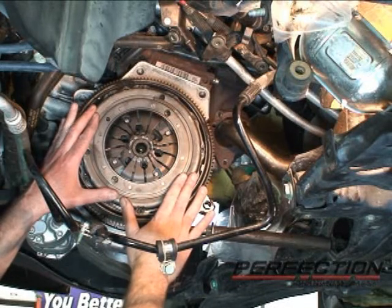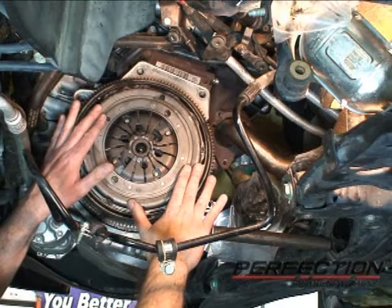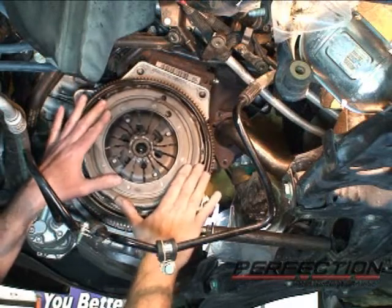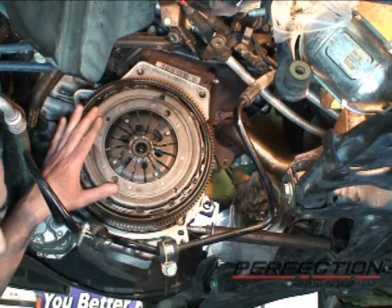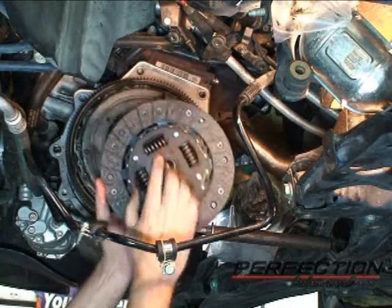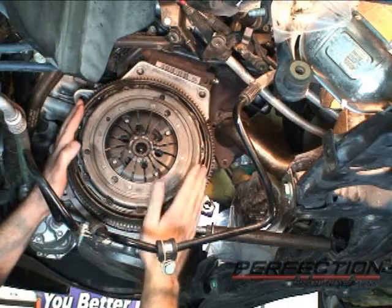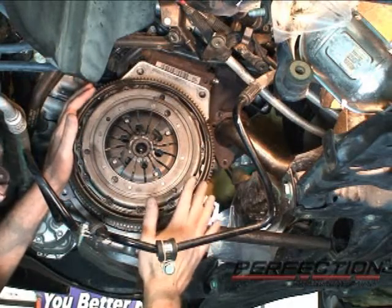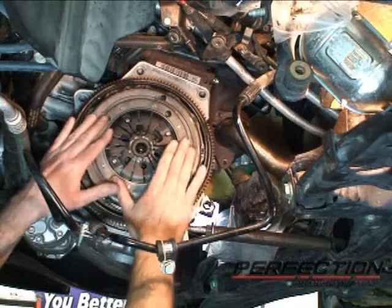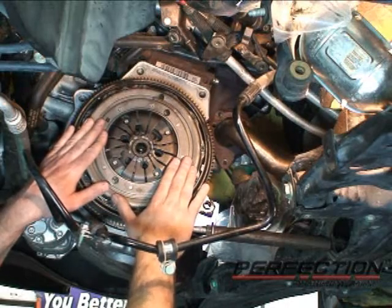One thing that seems to be a common observation when people look at a dual mass flywheel is that they observe any rotation out here as being a problem with the part — it's not. Every dual mass flywheel I've had my hands on has some rotation. What they did was they took the torsion damper from the clutch disc — this center section right here — and moved it into the dual mass flywheel. So the primary bolts to the crankshaft and has the ring gear. From the primary, the torque goes into the torsion damper, or noise filter. From the noise filter it goes into the secondary, which carries the clutch. They're technologically rather interesting. This one I observed something that I'm a little concerned about — we'll take a close look at that when we get the clutch off.